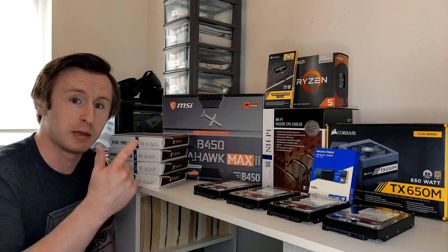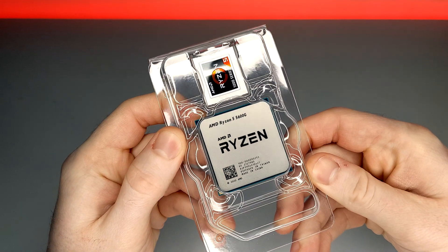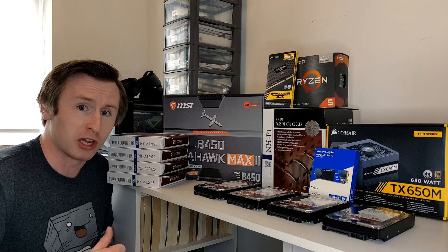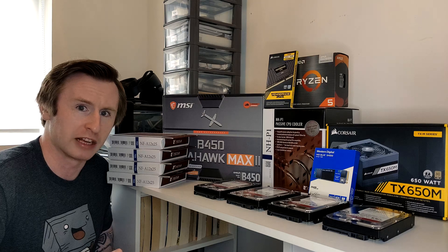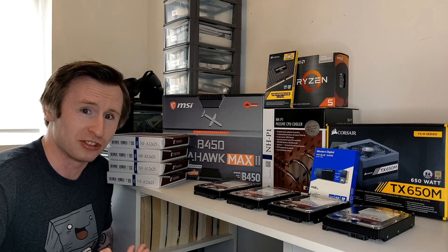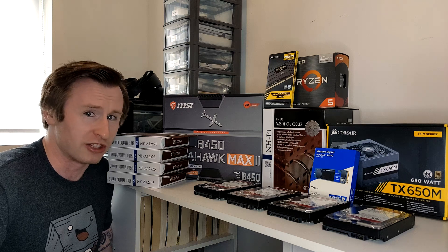To go through the parts, we've got the brand new Ryzen 5 5600G — it's a 6-core 12-thread processor. Generally speaking, this system isn't going to be under much of a load so this should do just fine. The benefit of going with the 5600G is that it has an iGPU already, meaning we can get away without having to add a discrete GPU. There is a slight downside as it does mean we are limited to non-ECC memory, which ECC memory is quite highly recommended for a FreeNAS if you're concerned with data integrity. But this is my first time and a lot of this is going to have multiple backups if I did have any critical system errors, so for now I can go without ECC — maybe that'll be something I consider further down the line.